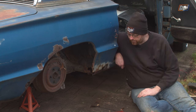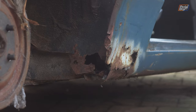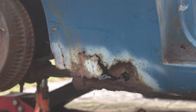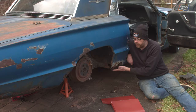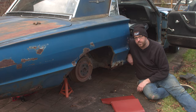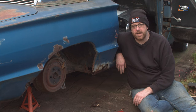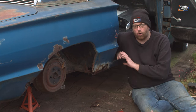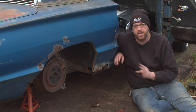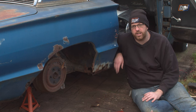There is also some other work that needs to be done — around this part of the back is obviously rusted out, and some of the floor that joins this panel onto the sill at the very bottom has gone. Those two bits I'm hoping are going to be relatively simple because they're just flat shapes. Fortunately, pulling the interior out was fairly simple — just a few clips to get the seat back and seat bed out, then pulling the seat belts. We've also pulled out all of the insulation — this really nasty fiberglass or rock wool — because I really don't want that blowing around when we get the angle grinder out.